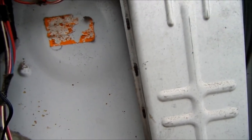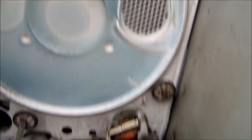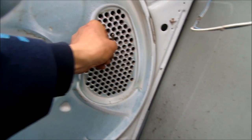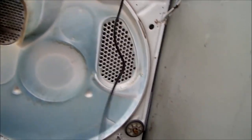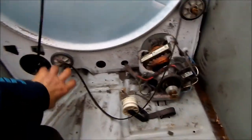We'll check this one — that one's good, and this one here is good too. So this looks like a good dryer. It's just a salvage machine, and the only thing that was wrong with it basically was some coins that fell down the chute. What I also want to check for is lint built up back in here. Sometimes you can just take a screwdriver and poke it through there and clean some of this stuff out — this one's pretty good, got a little built up but not much.